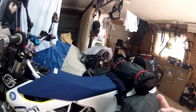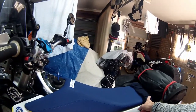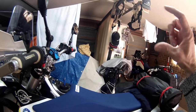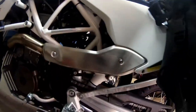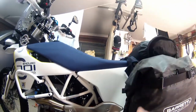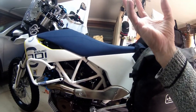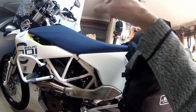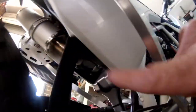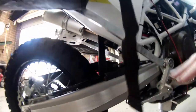Now, there's actually 3 ways you can fuel this back tank. Okay, the Rally Raid comes with an adapter. It's like a spacer that goes to the bottom of your fuel pump, under here. So you've got to take your fuel pump out, fit that adapter, and go from there. And then it has an outlet there for your fuel line. With that adapter, it does push this rear flap, the mud flap here, outwards, and it can hit your tyre. Okay, so there it is there. There's the fuel pump up in there. So that's one way you can do it.